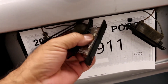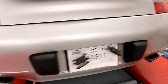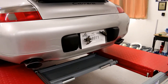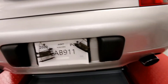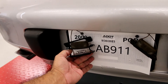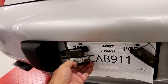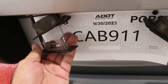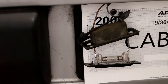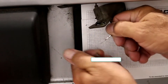Initially my thought was to order some cheap LED replacements so I wouldn't mess with my actual factory Hella light, but after doing a little research the Hella light is readily available, so I'm not going to wait for something to come from China. I'll put an LED bulb in one side, and I'm going to take the other apart and install the camera right here in this lens — it'll disable this light but should be fine. These are spade connectors; you just pull them off and wiggle back and forth to remove.